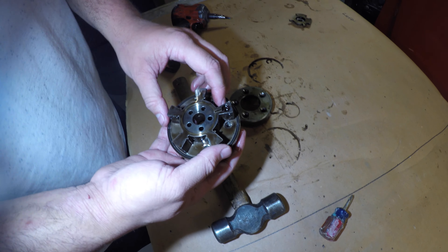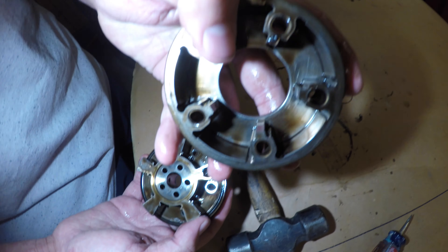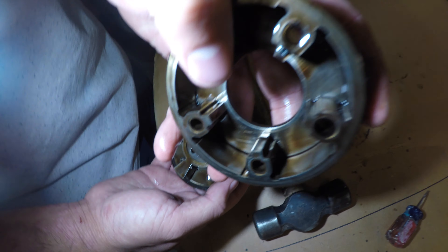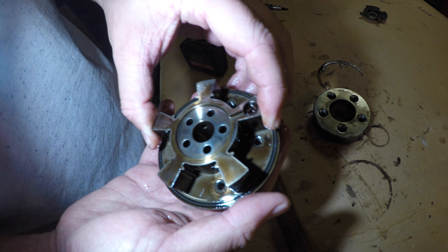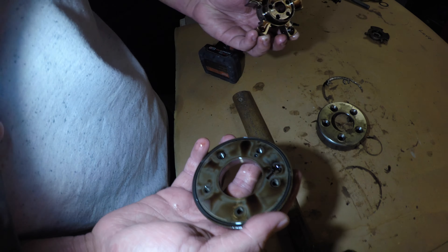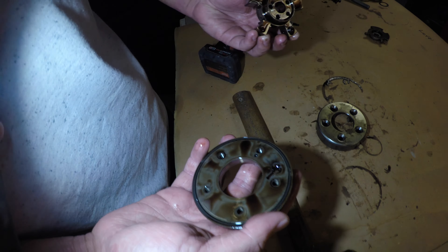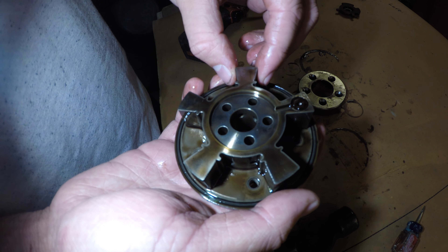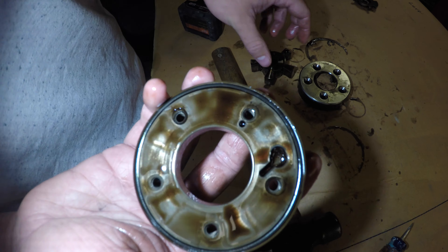If you want to know a trick to get these cam bolts out, specifically on the Audi 4.2 V8 — you're going to break all your T30s unless you do this, because I broke one or two. You literally have to take a metal hammer, not too aggressively, but give each cam bolt a good tap — like two or three taps — and then break them free with a ratchet. That's what allows those torque-to-yield bolts to let go and not break your T30s. Do that — it'll save your T30s, thank me later.